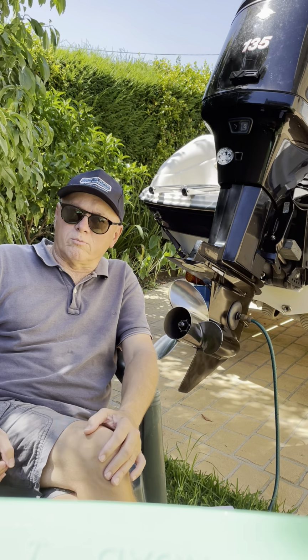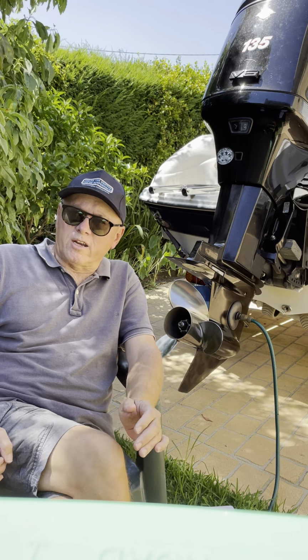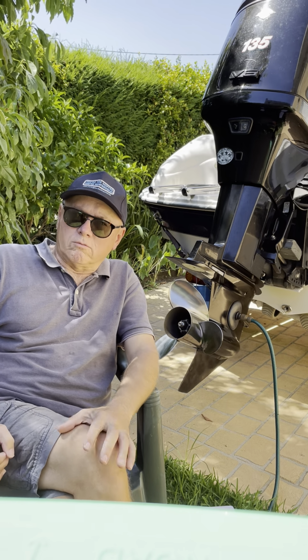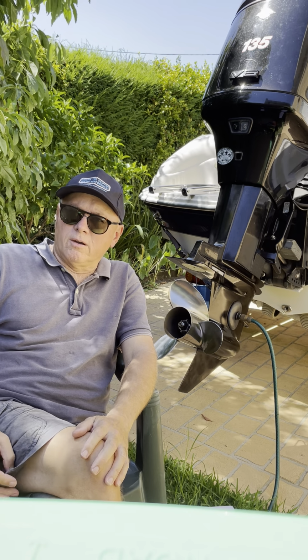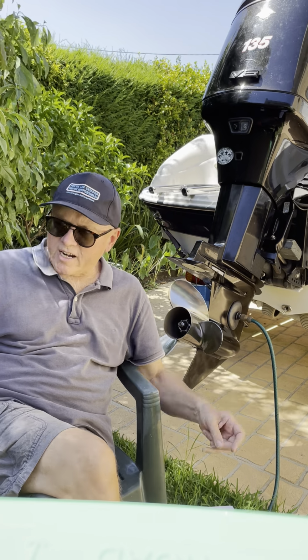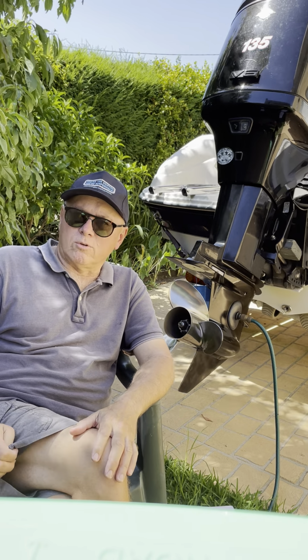Only use this oil, because as you can imagine, there's not a lot of it being used, and it's going to key spots on the engine, and other oils just won't measure up. You've got to use the proper Optimax DFI oil, and if you buy it in bulk, this was a 9.5 litre container, you can probably get it for not too bad a price.